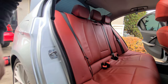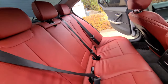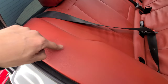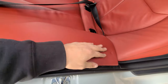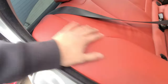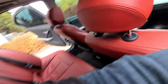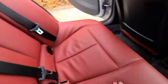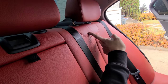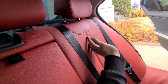We're done. As far as it goes, these panels only have the center clip up here holding them in, then a little metal piece on the side that guides it, and one in here that's totally useless on the E90. So only two out of three clips are actually holding these side bolsters in, but haven't had any issues - they sit pretty nice. The bottom seats clip right into the existing spots. The rears take some convincing, and for the latch on the passenger side I did have to loosen it off and shift it over a bit, but that latches perfectly.